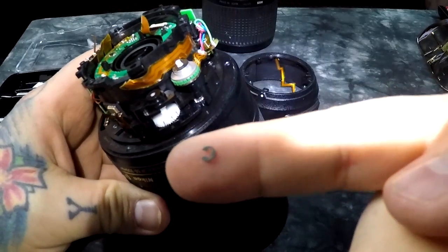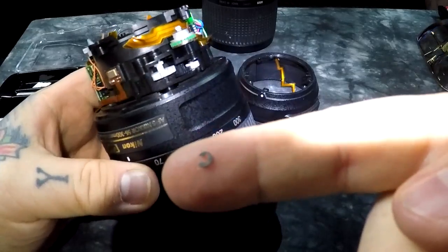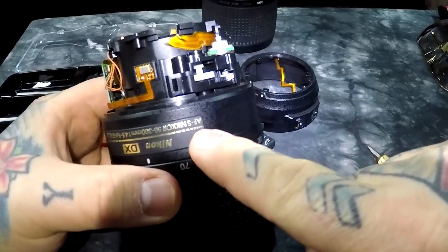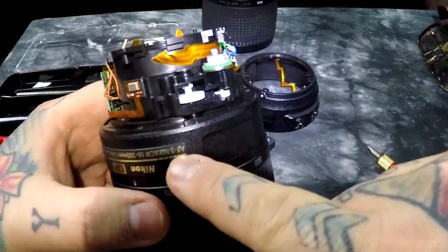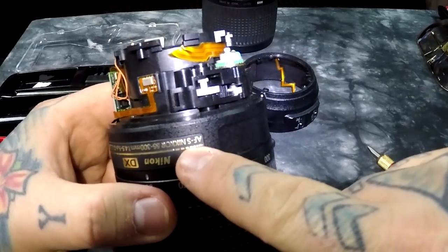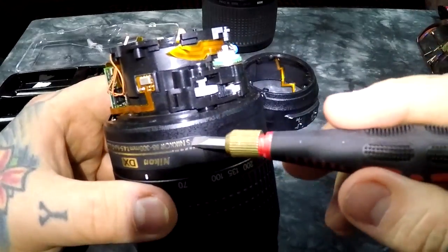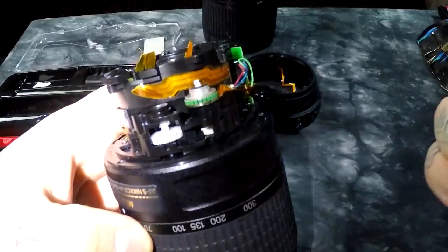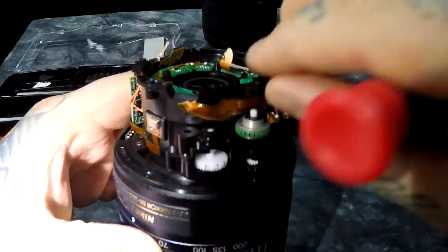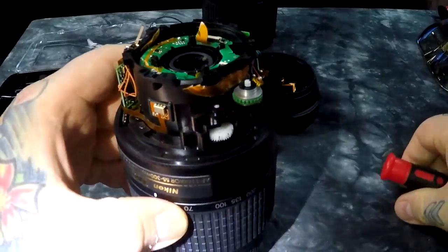See, Nikon doesn't want you to know that. There's a huge difference between one AFS-marked Nikon lens and another AFS-marked Nikon, because when you see AFS on your Nikkor lens it doesn't tell you a thing about what's inside. It's not a true ring ultrasonic motor - it's this chintzy piece-of-junk micro motor, and once the c-clip falls off, it's not going to work anymore.